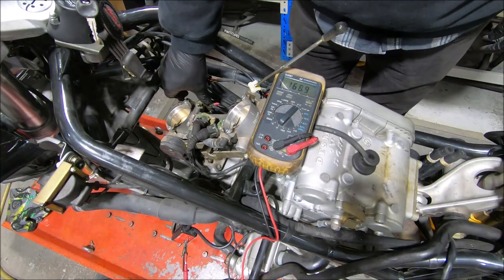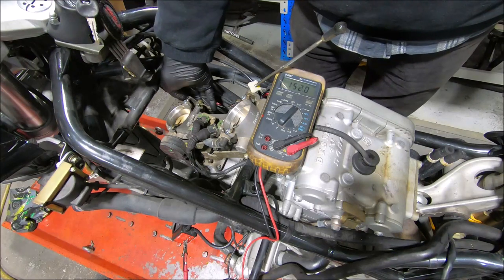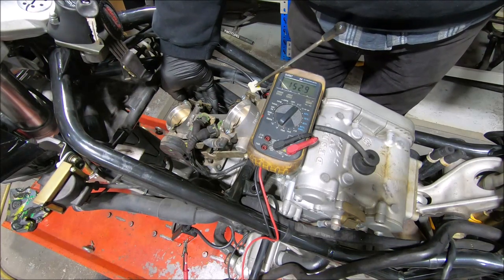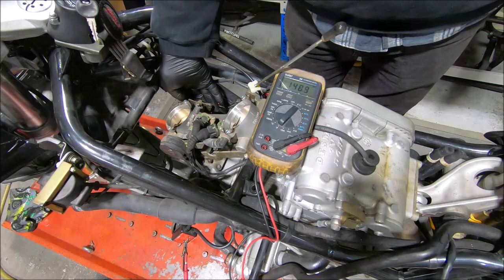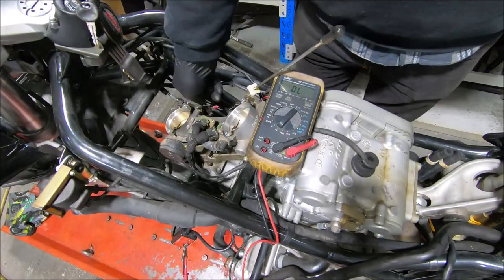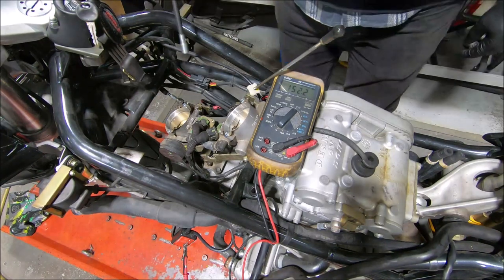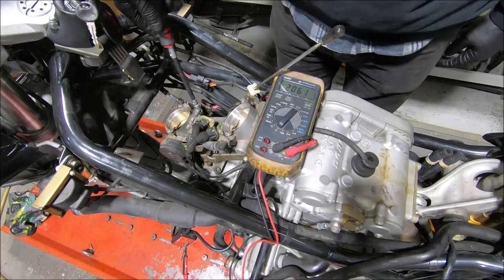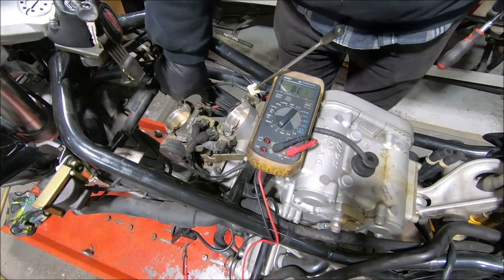Going to fully shut, you can see it's locking there now — 153 millivolts. It might have just been completely right. That's always nice. I usually just shut it and give it a wiggle so you can feel a bit of a snap as it opens again. It looks like it was actually pretty much spot on, which is very unusual. 152 millivolts. So now that we know it's okay, we'll wind the screw back in. This should be about 420 millivolts.